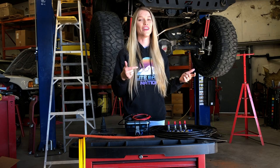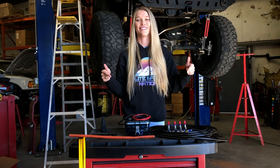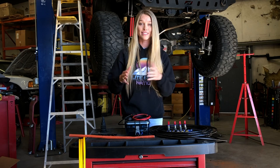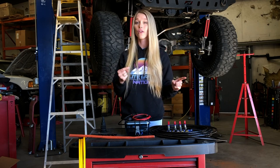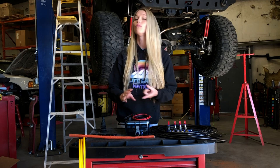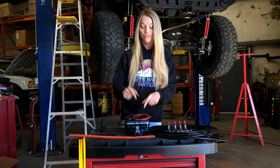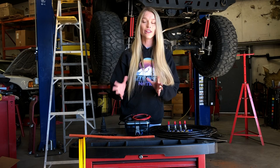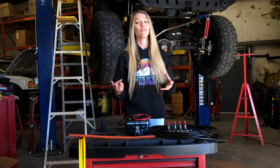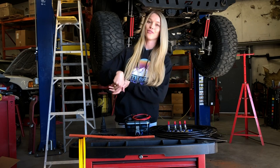Now for those of you that watched our previous video, you know what we're about to do today — you know what this is. We're still with Dan with Next Victory Motorsports. This is the Strikeforce Zebra Air Command System. In the previous video, I already went over the fact that they have two different setups: the single and the double. The double is more for competition use; the single is used for just about everything else. The solenoids inside this control module are rated for about 125 PSI. They're actually working on a third version rated for higher PSI, but since we have this fancy competition version, we're going to use that.